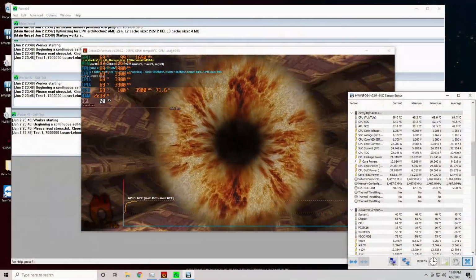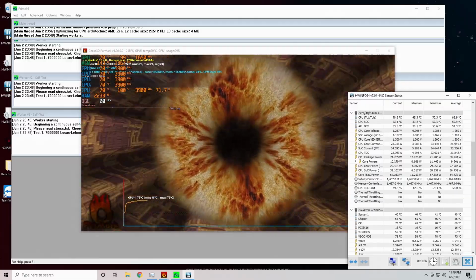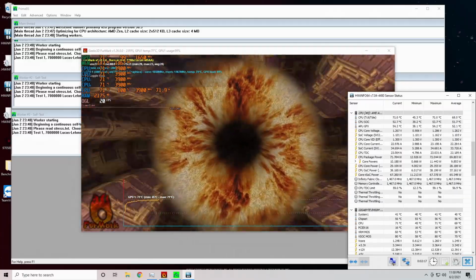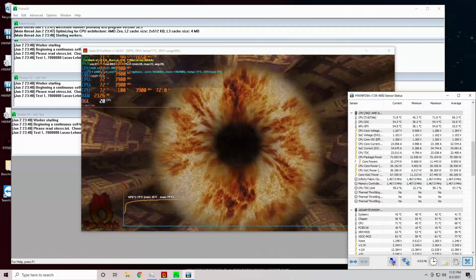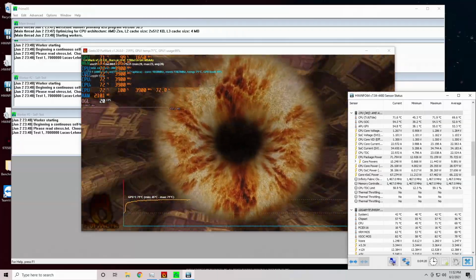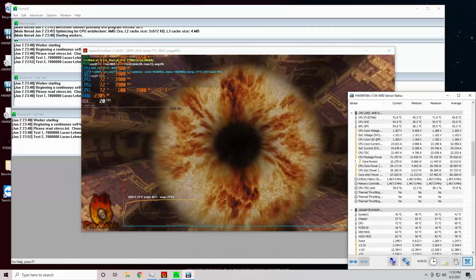Finally, to make sure the overclocking system is stable, I ran a 1-hour Furmark and Prime95 stress test and recorded information for longevity approximation. Recording is done with HWiNFO. A caution, I benchmarked this PC with an aftermarket cooler. If you have the stock cooler, temperatures might be different and higher.